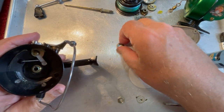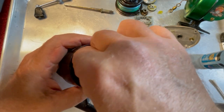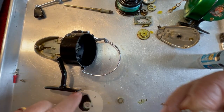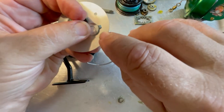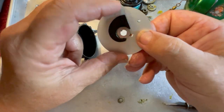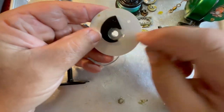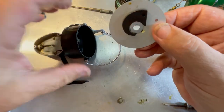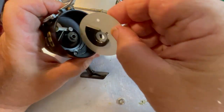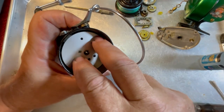Now we're going to reinstall these shims and put them back into place right there like that. Then we're going to install this washer — it's got a keyway right here, so when you sit this in, that keyway is going to drop right into there. What's going to happen is when you go to put this in, it's going to want to fall off. If it does, take it back off and put just a small dab of grease on it. Now we're going to set this baffle plate back in.